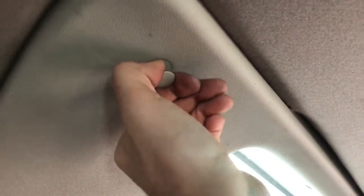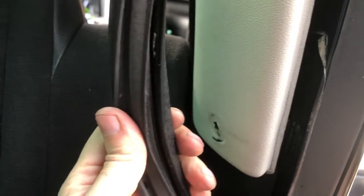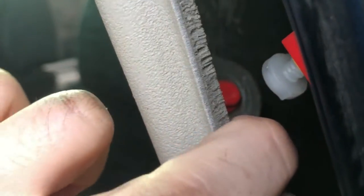It's not breaking — it's just popping out. Once you've got the trim studs out here and here you need to remove the door seal. It doesn't come out straight away — it's got a bit of a lip. There's a stud in there that was attached to this trim piece, so that needs to be put back on. Then it's coming out.